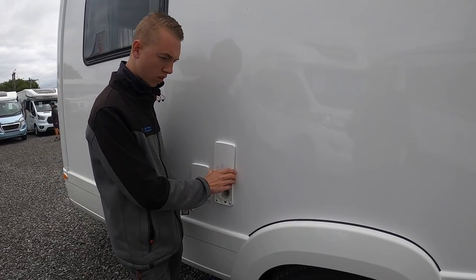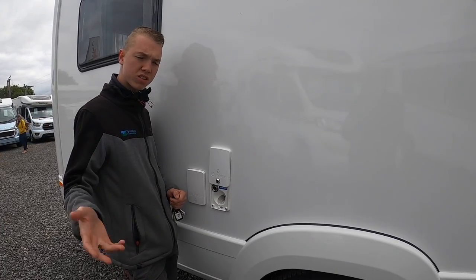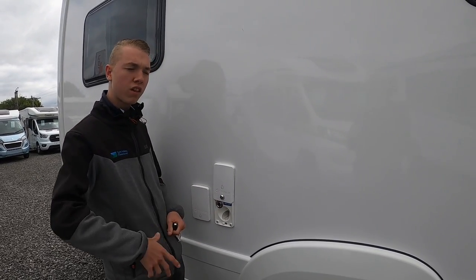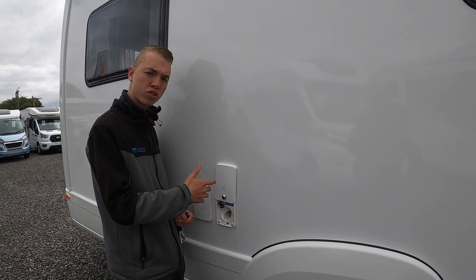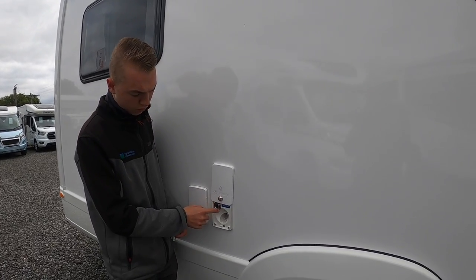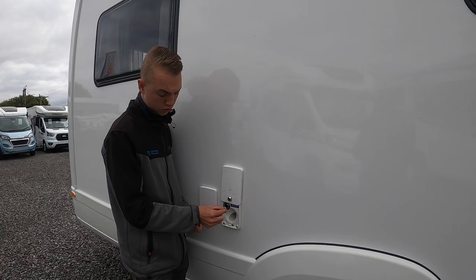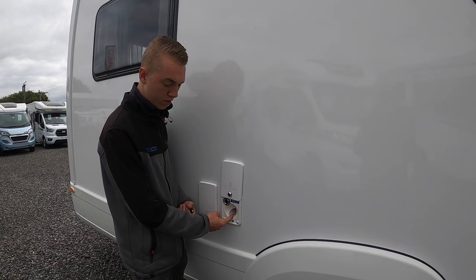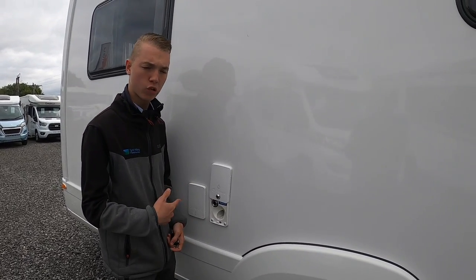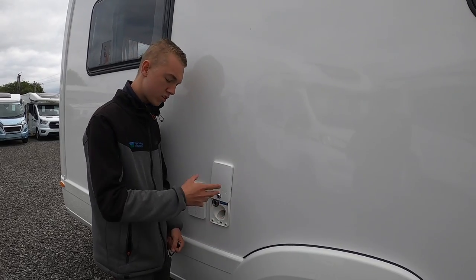If you are travelling while camping you will need a full tank of fresh water with you. If you are going to a site, tend to travel with a maximum of 20 litres. Should you not be able to fill the van up with water or get a hose to the van, you can get water to the van in an Aquaroll or a bucket. You've got a 12 volt plug here which is where you plug your submersible pump into. You pull the two prongs in, put the hose from the pump into here, and drop the pump into the water. Then you'd have to turn the tank fill setting on the main control panel, and that will pump the water out of the container into the main tank of the van to top your water up.